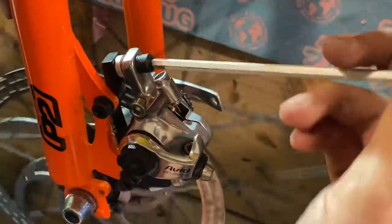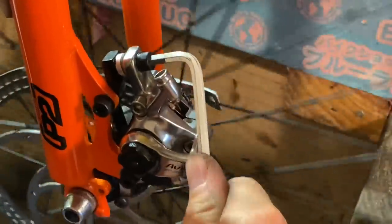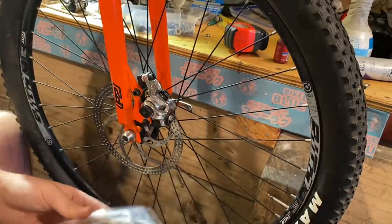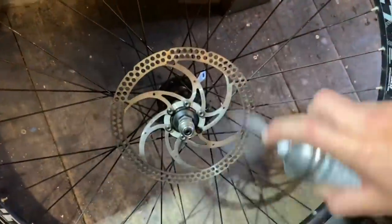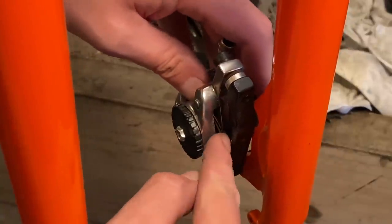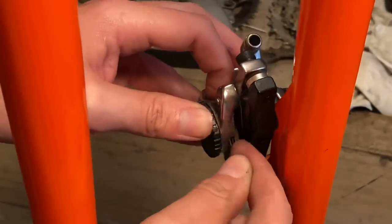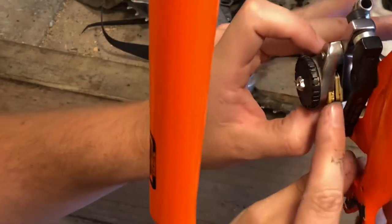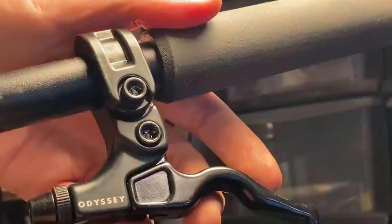I think I might get some anti-theft or bolt-on skewers just to clean up the look a bit, but for now this will do. With the calipers centered on the rotor and the pads centered within the rotor's braking surface, I was good to throw the cable on. These road calipers in this finish actually look quite nice. I believe the Road BB7 is the same as the Mountain BB7 — they just have a different cable pull ratio defined by a cam inside the caliper. With this brake adapter on and the caliper centered over the rotor, the pads didn't come out too easily, but I got them in eventually and then could throw the cable on.